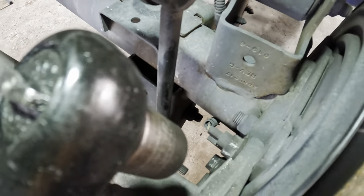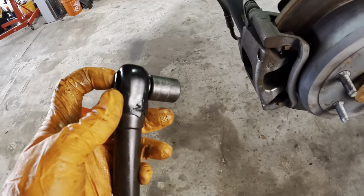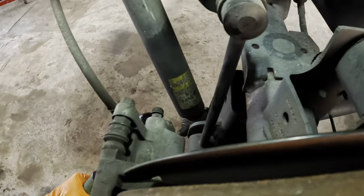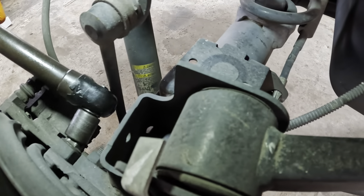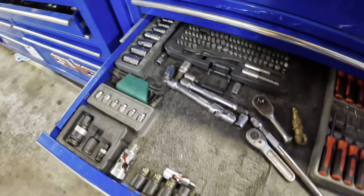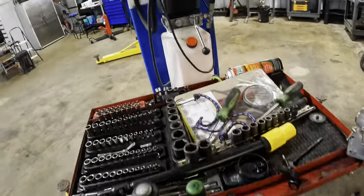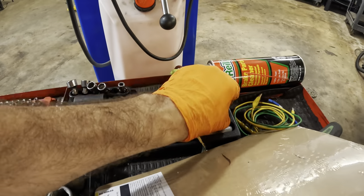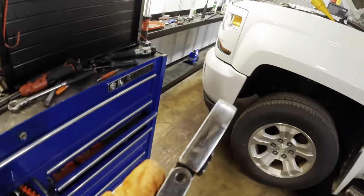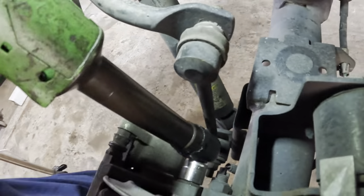Coming around the back side, we're going to pull the caliper bracket bolts off the axle and just leave the caliper on its bracket — that's fewer components to remove and install. I don't have the space for a standard impact, so we'll use a low-profile socket. Where is it — I moved them over here. There it is: 18mm super shallow low-pro socket. I'll bring the ratchet wrench because it's super low-profile. Does it fit? Look at that — it fits!